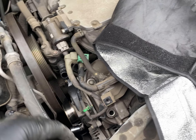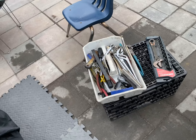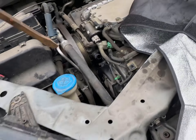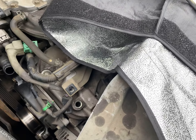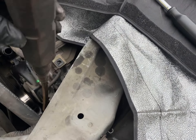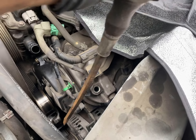When I got the tool in there, it got stuck in position — I could not get it out. What I had to do was bang at it with this long screwdriver right here and use a hammer to get the tool out. Because with the belt off, the spring tension pushes it all the way this way and it's very difficult to come out. Maybe have one person pry it out while you bang it from this side.